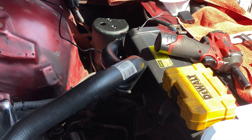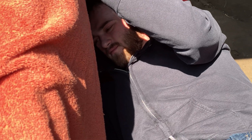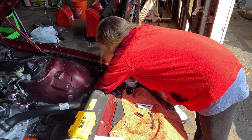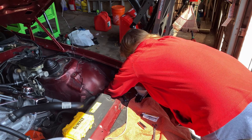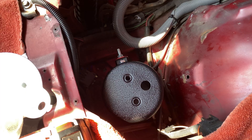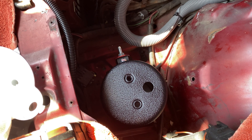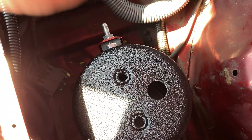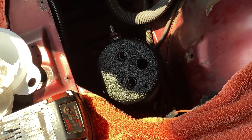The canister is in place, but he's got to put the nut and bolt on the bottom, which means crawling under the car. Thankfully it's within easy reach and relatively easy to do. Alright, it's installed. Now the next step is to hook up the hoses. For now he's going to leave the bolts long, but if they start to bother him he can just cut them off with a hacksaw or Sawzall.